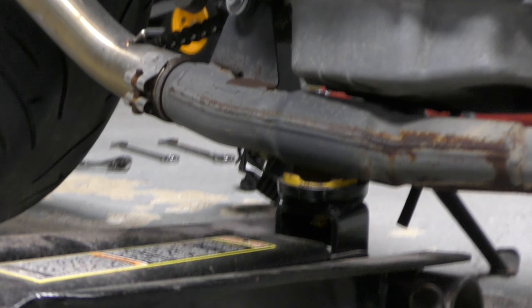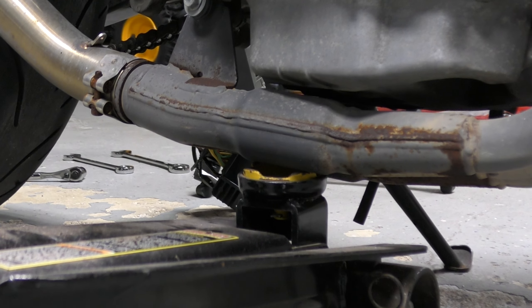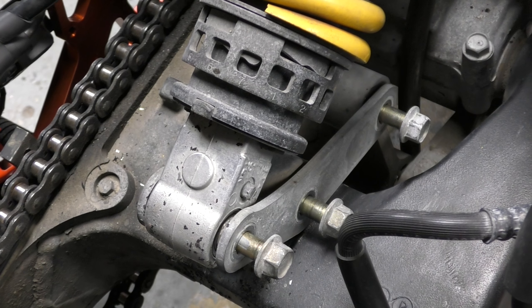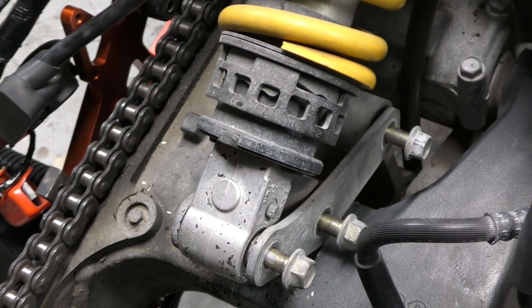I just want to point out how high I jacked it up — not very much, maybe five or six pumps of the jack right on the exhaust. If you come up to the plates here, you can see the bolts. I'm just using my fingers and you can pull these right out. That's right where you want it — you pull the bolts out, the plates come right off, then you slide the bolts through the new plates, put the nuts on, and you're good to go.